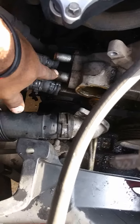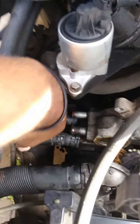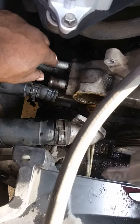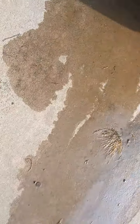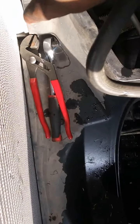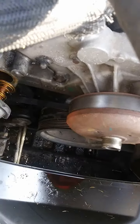I just slid that off. It's going to be hard, so you've got to use pliers or something to pry it off. Loosen the clamps, bring them back, and try to get it off with a flathead to unstick it. I used my pliers to grip it off and slide it open like that. You'll need a new thermostat — new thermostat and water pump.